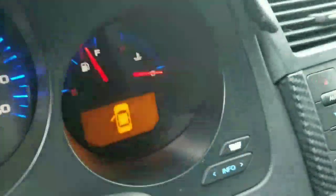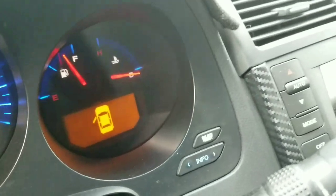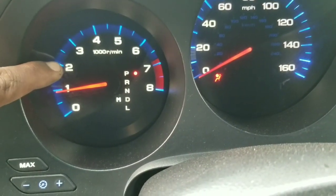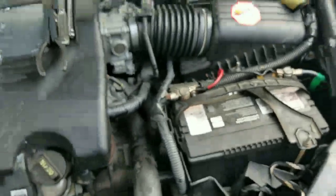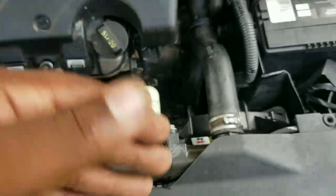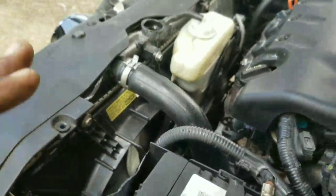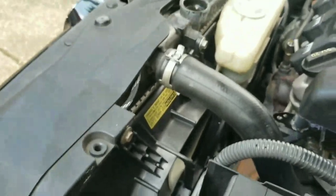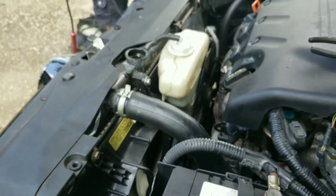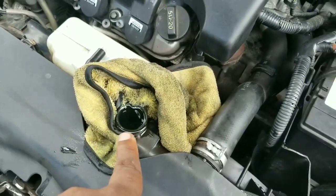Right now the temperature level is on cold so it's still cold. Another way of getting the fan to turn on is to hold it to 2000 RPM so it fully warms up, then listen for the fan to turn on and off — that's a quick way of doing it. Wait for the fan to turn on once, then turn on twice, so you know it's functioning. If you have any questions feel free to ask. Don't forget to like, share, subscribe, and comment. As you can see, the bubbles are coming out of the system from the air in the system.